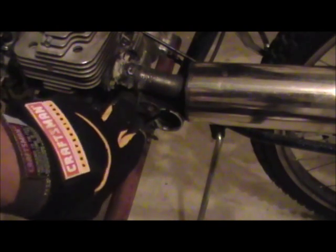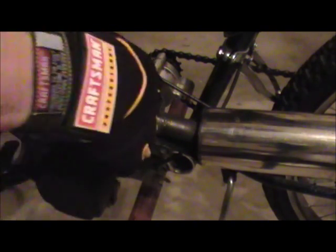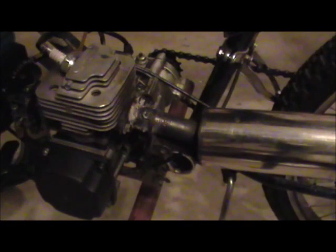As you might be able to tell, I welded it because I was driving it and the other day it broke at the weld that a muffler shop put on there because it had no penetration. I'm glad I tacked a little place on the bottom because it was leaking a tiny bit — that kept the muffler from falling off. I'm going to try to get a different muffler and attempt to get rings from the salvage yard; if they don't have them they're like eight bucks online. It's cheap Chinese crap. And I'm going to get a folding shifter for my bike.